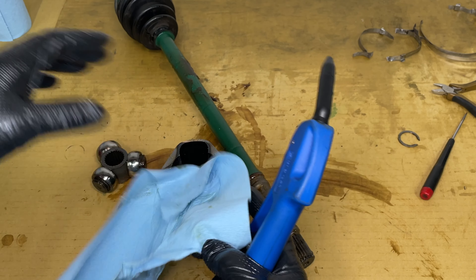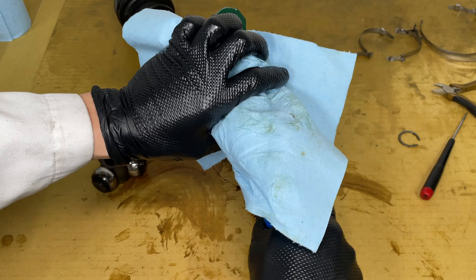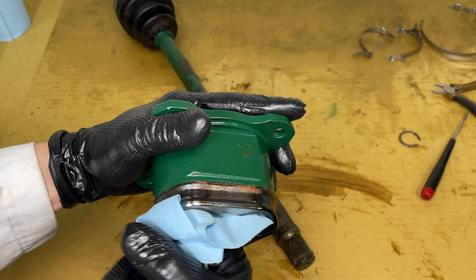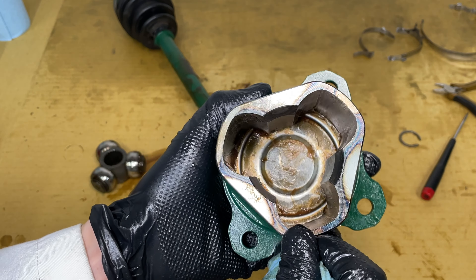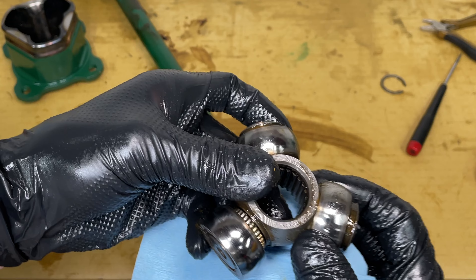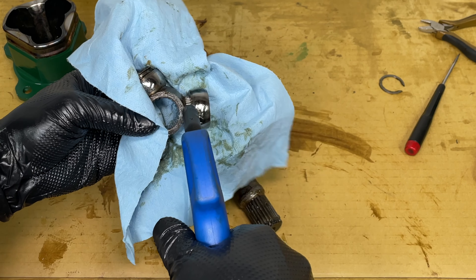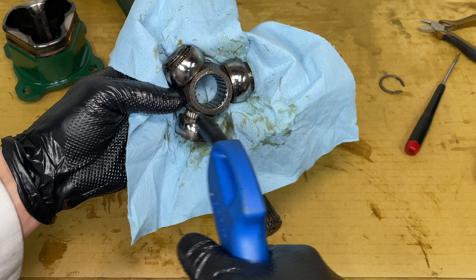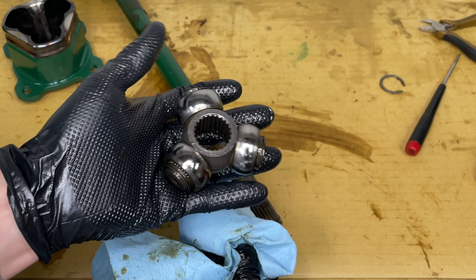You could also use a little compressed air, but make sure to cover it so you don't get a giant mess. The air moved the grease around a bit, so now I can wipe it out. This part is actually in really good condition — there are no scratches and it just looks nice. I'm going to try to get as much grease out of these bearings as possible. A clip holds the wheels on so we can't drop all these needle bearings. I'm going to use a little compressed air here — don't use solvent, just get most of the grease out. And this piece looks very nice — there is no scuffing on the bearings. They look new.